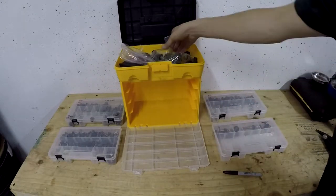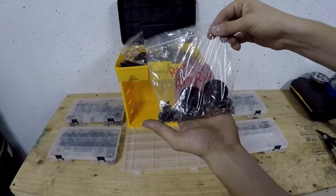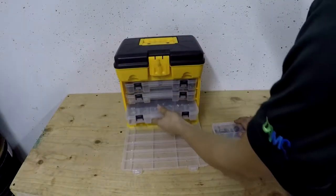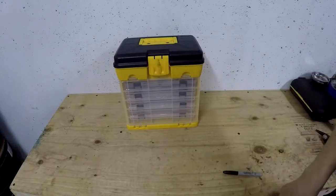For really big stuff or awkward things like camber bolts that are too large to fit in the trays, individually bag them and keep them together — or you're going to have a bad day. Make sure you keep everything in some sort of order so that when you start rebuilding, you can work your way backwards from where you started.